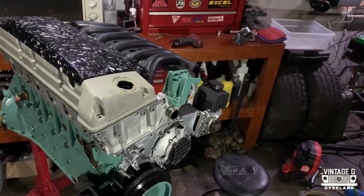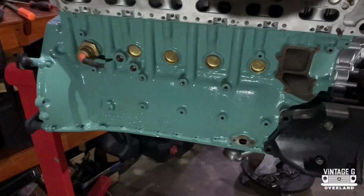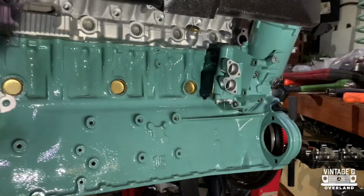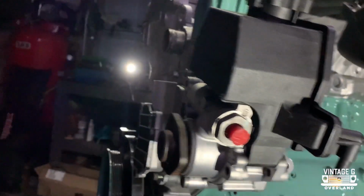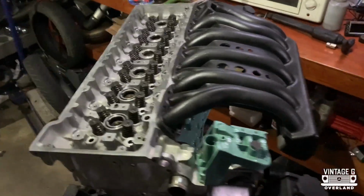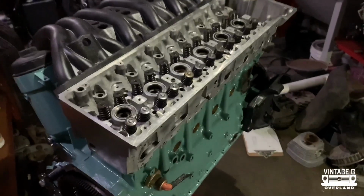This was an inline-six 3-liter diesel engine that revved out to 6,000 RPM and produced around 173 horsepower. I know this doesn't sound like a lot, and nothing really to write home about here. However, Mercedes overbuilt the ever-living heck out of this engine. With stock internals and just a few bolt-ons, you can safely get to around 500 horsepower with absolutely no effort at all.